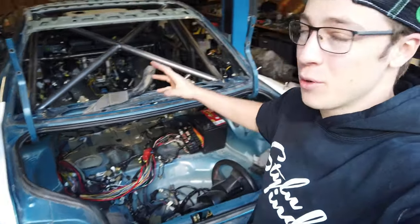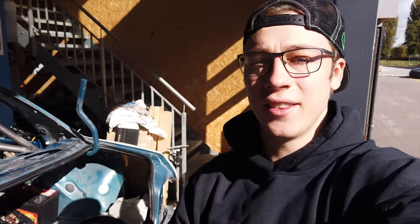There is still one part of the wiring that hasn't been addressed - all of the cables running from the battery to the starter motor need to be extended as well. The bad news is it's a little bit more complicated than just extending the cables, because we need to add a circuit breaker and some terminal posts to disconnect everything in the front. But the good news is I do have everything in stock so I can go ahead and do it right now.